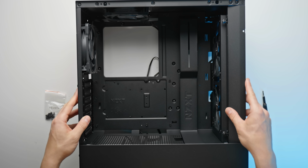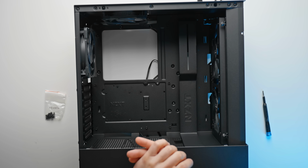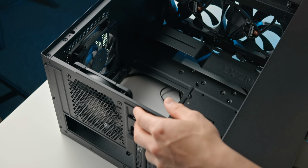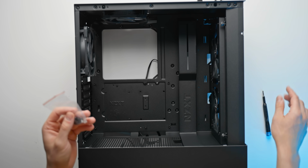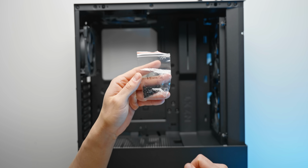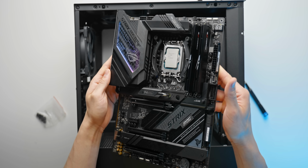All right, so I'll be honest, most of the boring stuff is over. Now is where it gets really exciting and we can actually start putting this PC together. Most of the parts leading up to this point have been kind of like preparation and stuff like that. I think most of us will agree. Next up, we are going to install the motherboard. So what we need, of course, is a screwdriver and the screws that say 6-32 screw flat on the front. And of course, the motherboard that we prepared earlier.